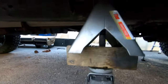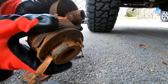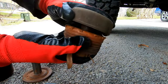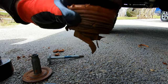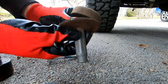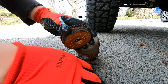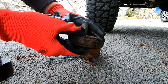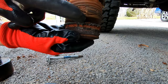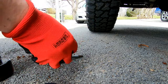Let me show you how this goes together. This is the rear cab mount closest to the bed. This goes in there like that, then that will go down through the frame. Here's your threaded end, your bottom cup, and that piece actually has a foam insulator on it as well — and that'll go together just like that with your frame in between.